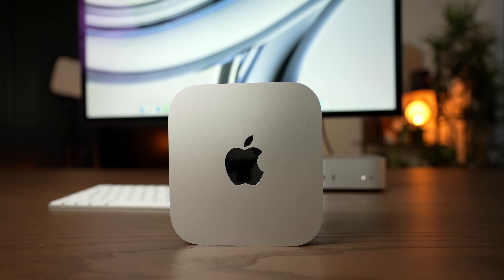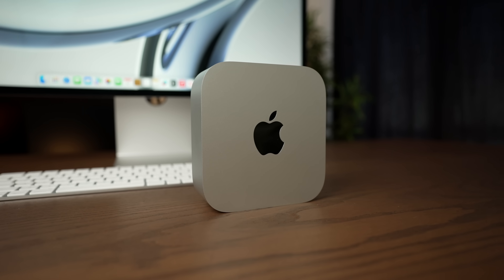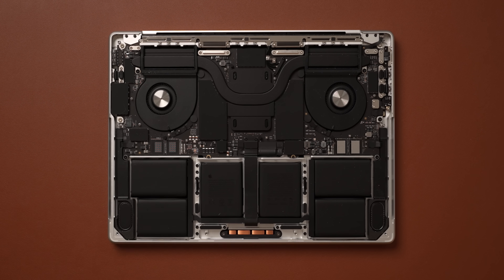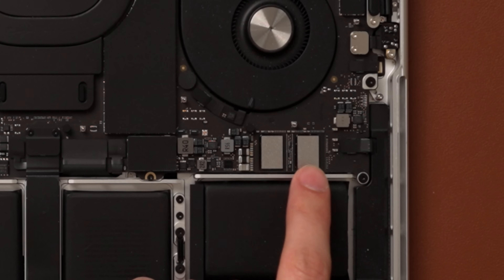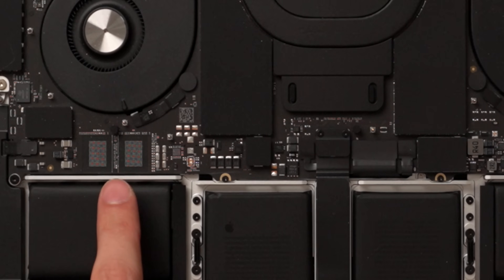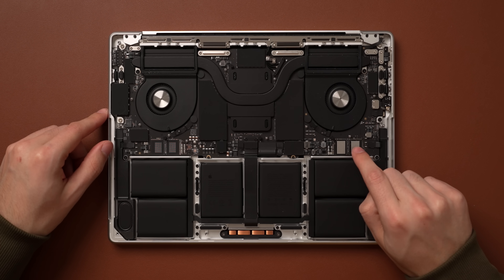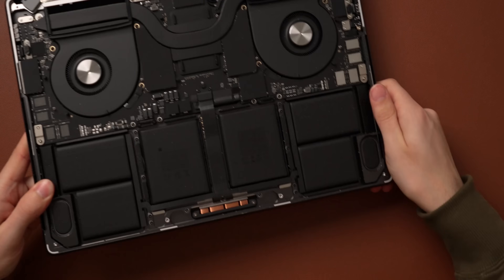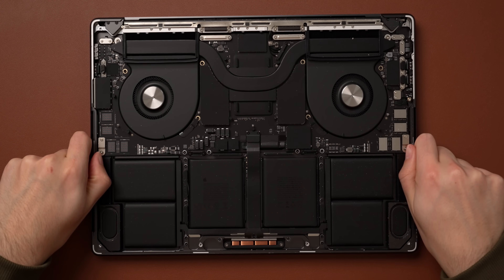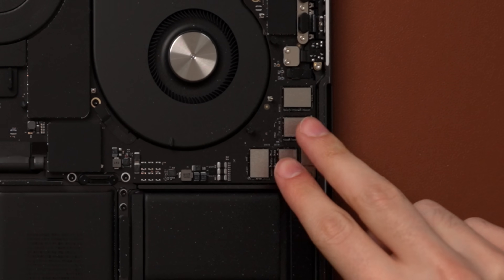That complication only really exists on these removable storage cards. In a MacBook, here's my M4 Max MacBook Pro configured with one terabyte of storage. You'll notice modules are populated over here, but over here they're blank. This board is actually double-sided, so there are two more NANDs on the underside and two more blank pads as well. Here is a 16-inch M3 Max MacBook Pro — one, two, three, four NANDs — and this is also one terabyte, so you're getting four 256s to make up that SSD. On the other side, there are four blank pads.